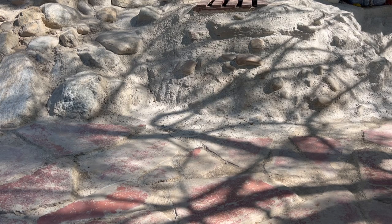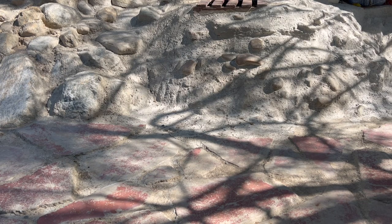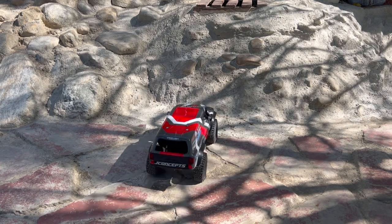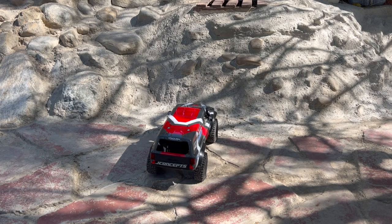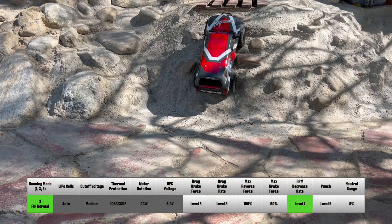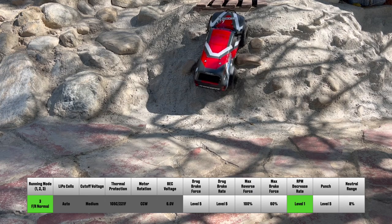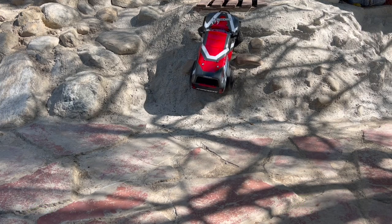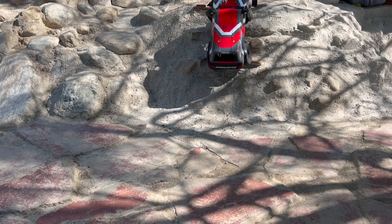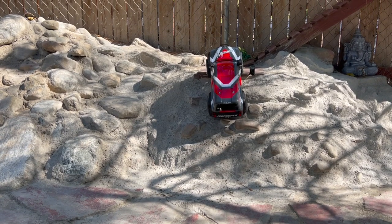The higher the value, the faster the change. If you want to achieve the experience of natural sliding when reducing the throttle, this value needs to be set small. It is by default set to 1. That's not bad. How will it impact drag brake is the question. Right when you tip in there's just a millisecond of it trying to catch up. The throttle feels a little more punchy — it doesn't feel as smooth as it does in just the default mode one.